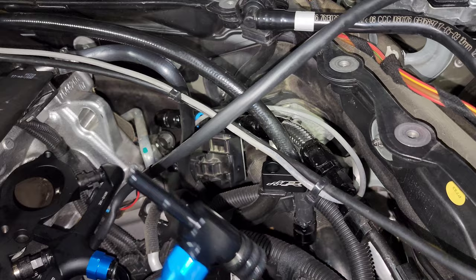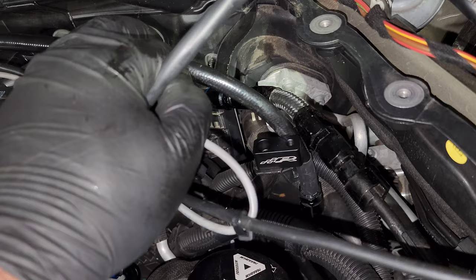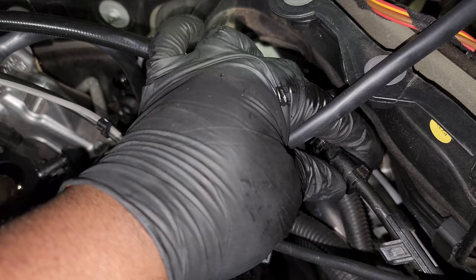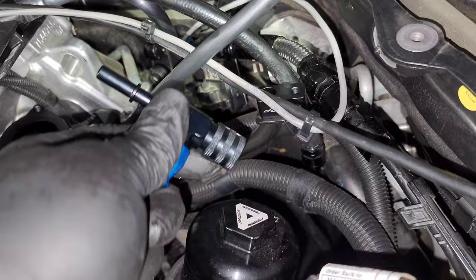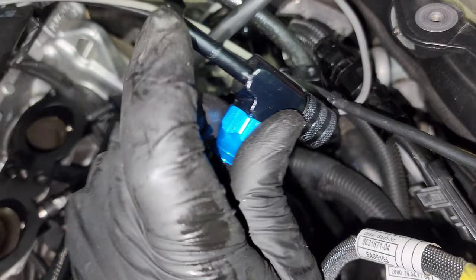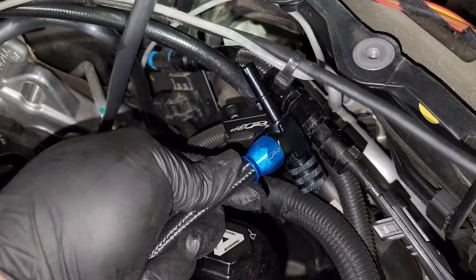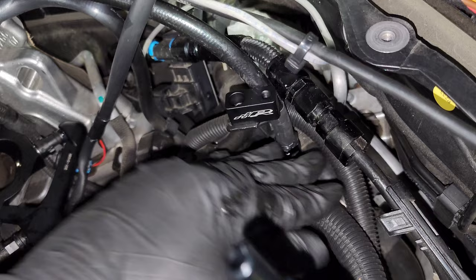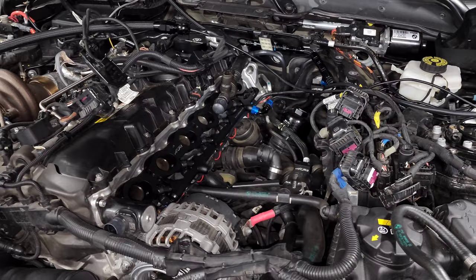Next, install the fuel line. I have a DIY flex fuel sensor on here already so I'll need to rebuild my line later, but if you have the regular low pressure fuel line, just disconnect it from the hard line feed that comes up into the engine bay, then clip the new tee fitting on and snap the other side of the feed line onto it. It tees off from the low pressure feed to the high pressure fuel pump. Put some rags underneath to prevent fuel from spilling, then install the feed line.